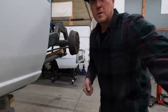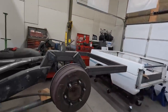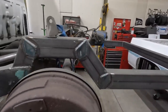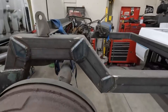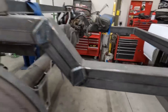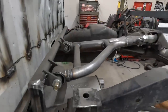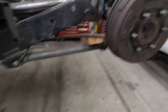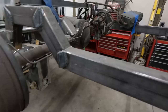Let me show you what I've been working on — this is the rear frame clip and step notch in the frame. I built that out of 2x3 120-wall tubing and it's all grafted into the stock frame. I've already started on the suspension: it's got a wishbone upper and straight lower, so the link is all sorted out. Now I just have to figure out this rear axle.